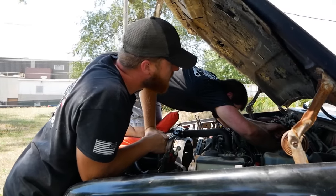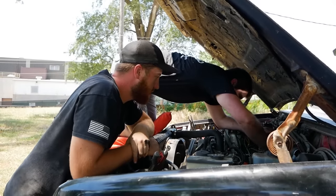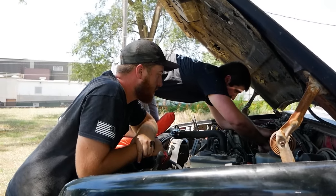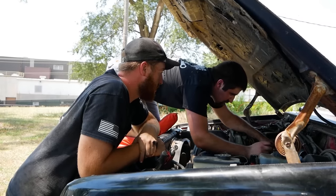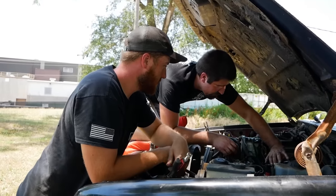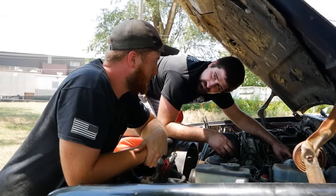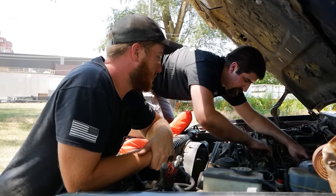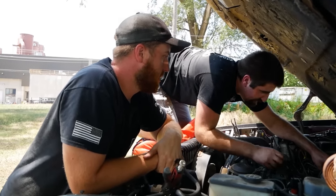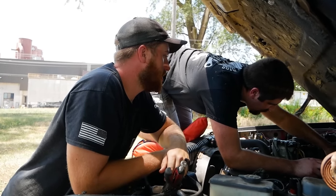Just like any internal combustion engine, if you put too much timing or too much fuel to it, you run a higher EGT. And diesels are more prone to it because they are what is called a lean burn system, because there's no throttle valve on the intake manifold. It blows my mind that you can just regulate RPM based off of literally just fuel. More fuel is go faster. You can only spin as fast as the fuel you have will allow you.